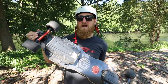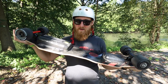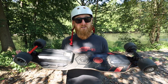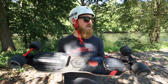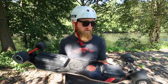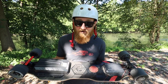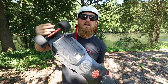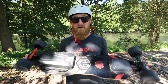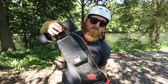All dual hub motor boards nowadays should absolutely be going over 20 miles per hour, so this one did not disappoint in that department. When it comes to the advertised range of 23 miles, plus or minus two — worst case advertised would be about 21 miles. I didn't come anywhere near that at 14.91 miles. I gave it the best conditions possible: one hill test, then smooth pavement laps. It just came up short. Granted, on a flat track, about 40 pounds lighter, in medium mode you could probably stretch those numbers, but I test in real-world conditions like a normal commute.